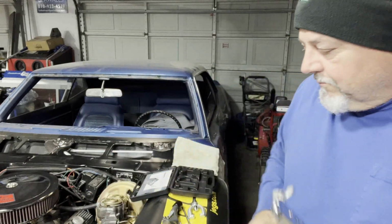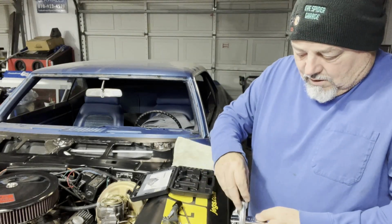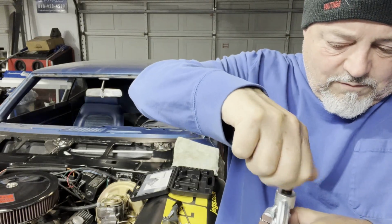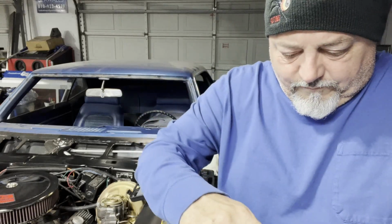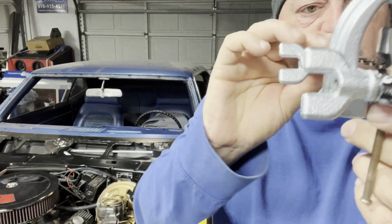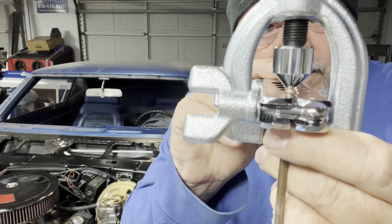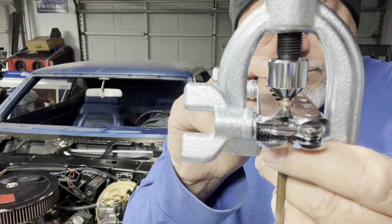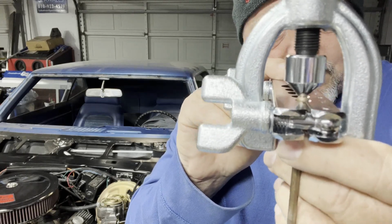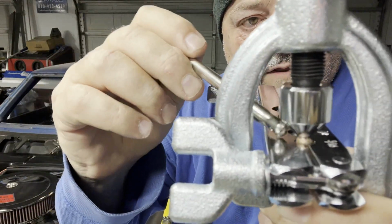After you get the preform, put the press tool back in like this. You center the press tool on the end of the tube, which I'll show you here once I get this snugged up. Okay, so now the preform is complete, and we have the flare that's going to be put in by the press tool itself. See that angle? That's the angle that the flare needs to be at. See here. This angle right here.